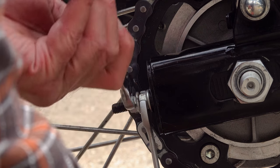As I've said, I usually re-lube about every 400 miles, and I clean and re-lube after every 3 re-lubes, so about every 1200 miles. Chain adjustment, obviously, is going to be dependent on when it needs adjusting.